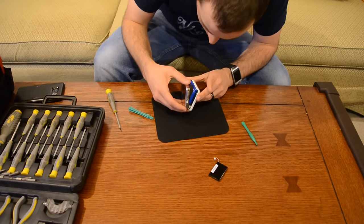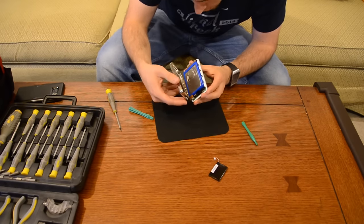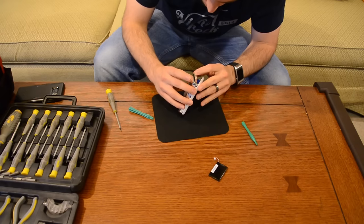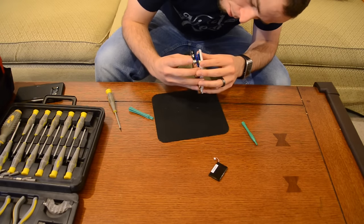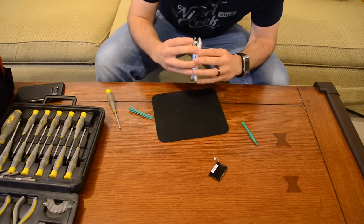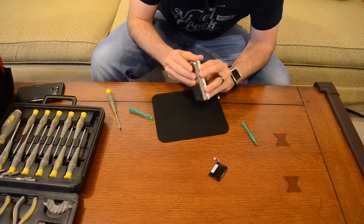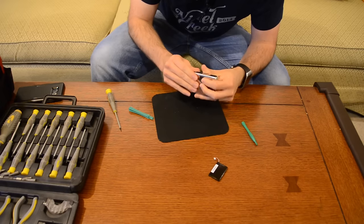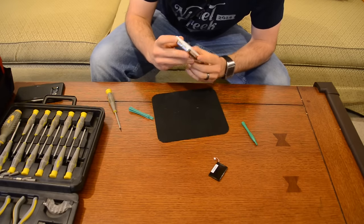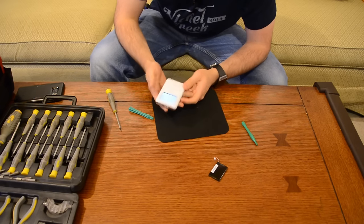That's back in. As you close this back together, do a quick check — make sure you're not going to pinch any wires, and make sure the hold switch is in the same position so you don't break it. Based on where it was, this thing was off hold, so I want to put it back that way. And we have a working iPod — backlights and all!